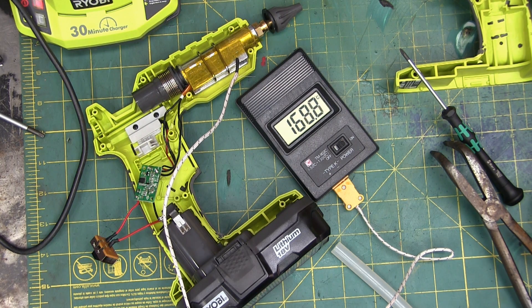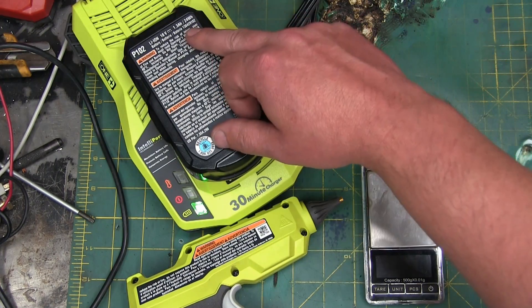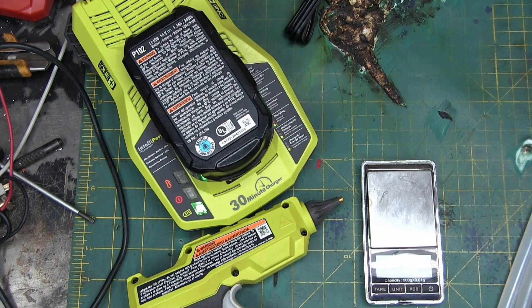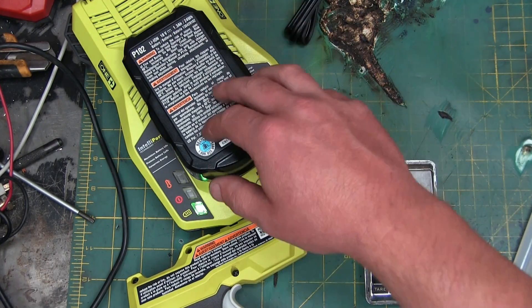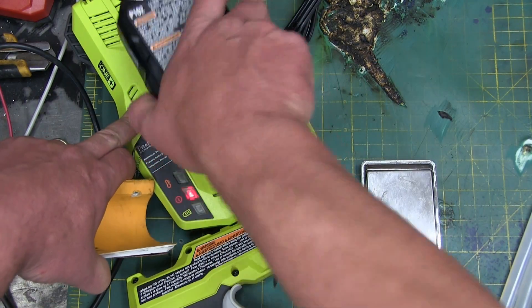With this 24-watt-hour battery at 100 watts, that should be a quarter of an hour — 15 minutes. So I think probably 10 minutes is a safe bet for this to run on the small battery. We are going to see how much chooch for your charge.